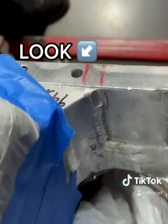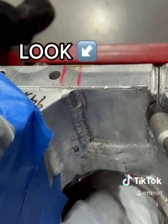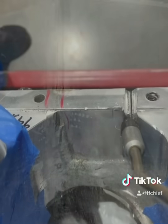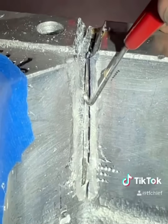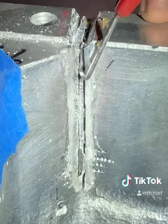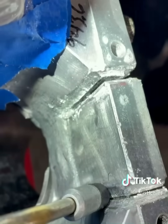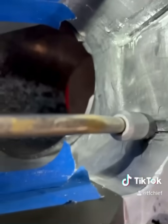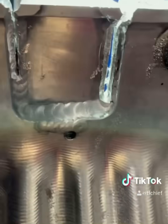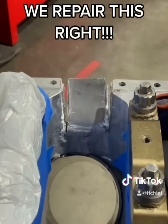After slicing a hacksaw down through it and blowing it out, I noticed it's actually blowing all the way down through the channel and back up the other side. So we started grinding away on it, and we found someone had put a piece of aluminum in between the chunk they were welding in and the block. You can see how that was bubbling up when I was blowing clear on the other side.